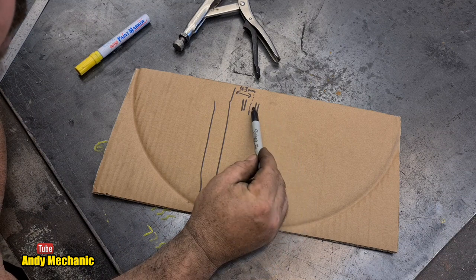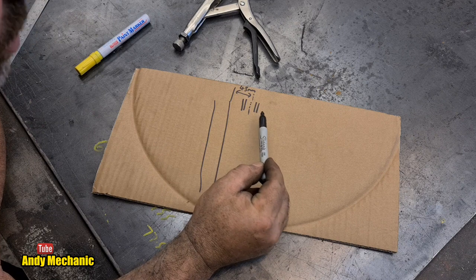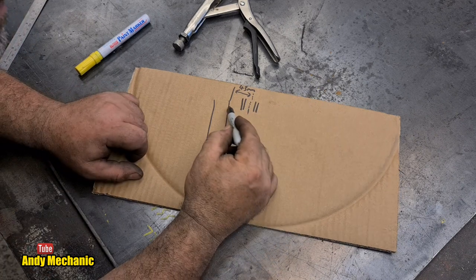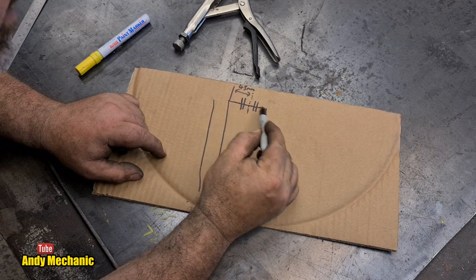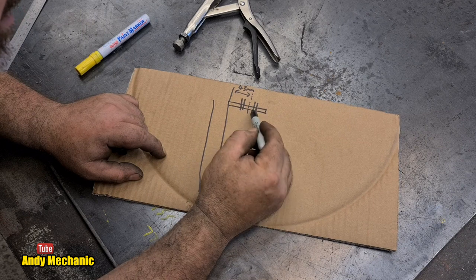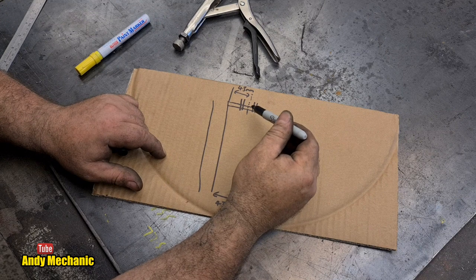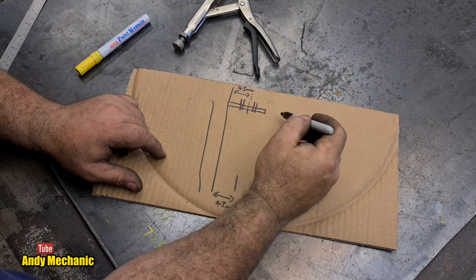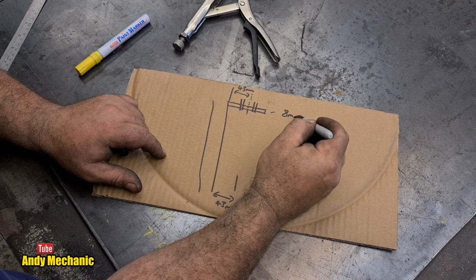So these are going to have to be spaced far enough apart from the centre line so we've got room for those little wheel adjusters and stuff. So the bracket is going to sit across here, like that, off the chassis. What I'll do is find a nice thick bit of steel, probably about 8 mil, to give us plenty of thread depth. So 8 mil plate, maybe, if I can find some.